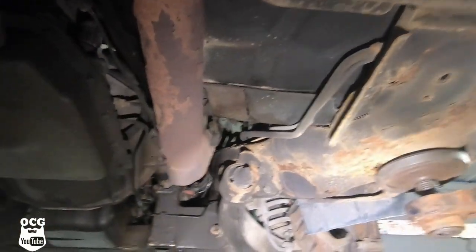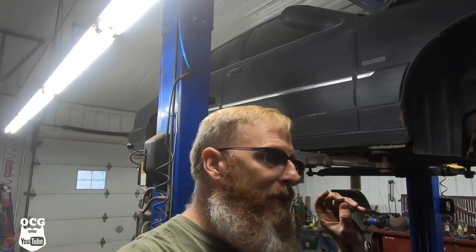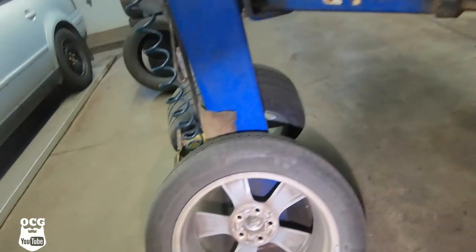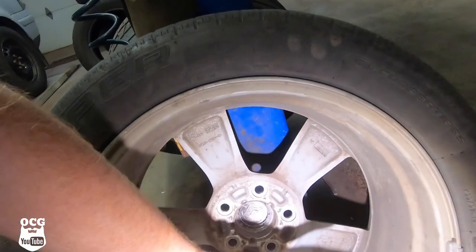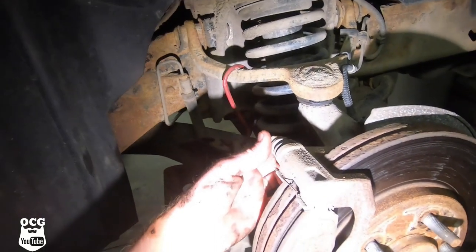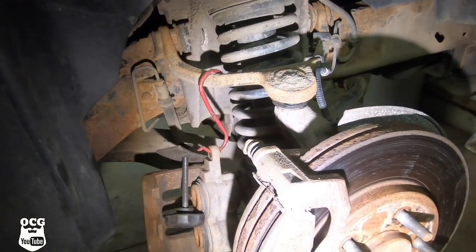We're going to look at the suspension, which I've already checked and everything seems okay. The only major concern to tackle today is the brakes — I've been driving this thing for about a week and the pedal felt really spongy, like you've got to mush down on it to get it to do anything. I'll explain why any vehicle will do that. Here's a good example of rusty rotors — you can see the discoloration where the mating surface of the front wheel was. On brakes there are moving parts: this is a dual caliper, and you've also got your caliper slides right here, which allow the caliper to move as the pistons move and as the brake pads wear down.